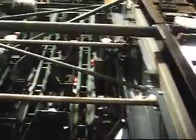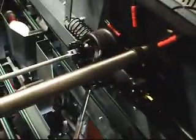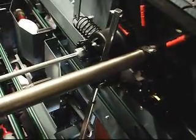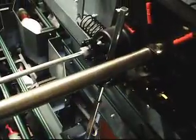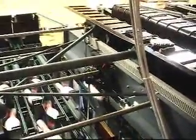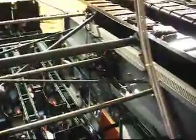Now that I got it tight it should be able to operate fine. Same lane — the machine is cycling on the same lane successfully. That's what it was this time: it was that drive gear across the slip clutch shaft. Just press it up tight, tighten it down with your 3mm allen wrench and it should be getting you back up and running.